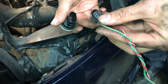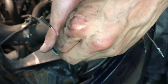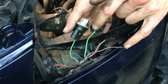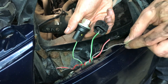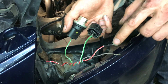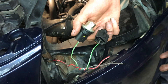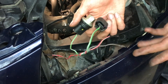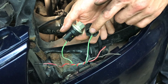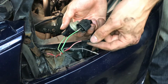It has three pins on one side that press in, so it's like a male pin, and then on the other side it's a female pin. I left two of them without any tape so that I can read between ground and the output. Make sure that you never let the red pin — 12 volts — touch either of the other two, since they're going back to the computer. Even though the computer is kind of powered by the car battery, not all the pins are 12 volt tolerant, especially this one, because it's like 5 volts or something. Ground would be bad too — you could damage your computer if you let the 12 volts touch.